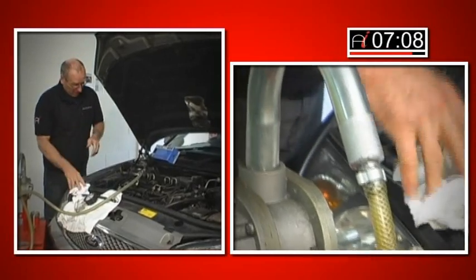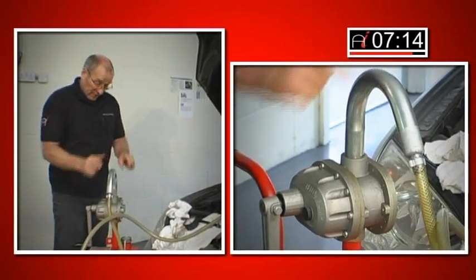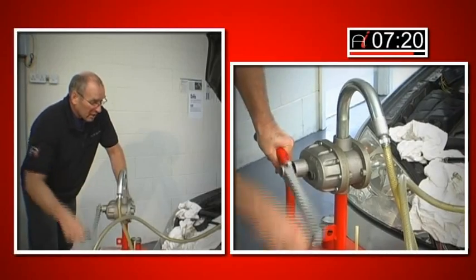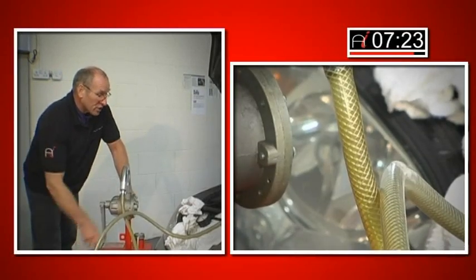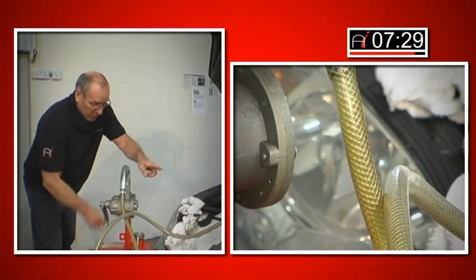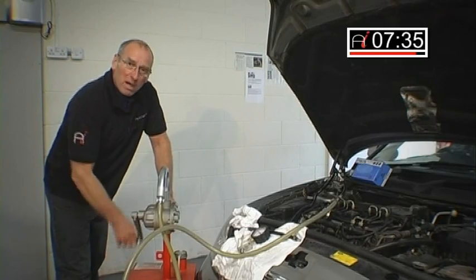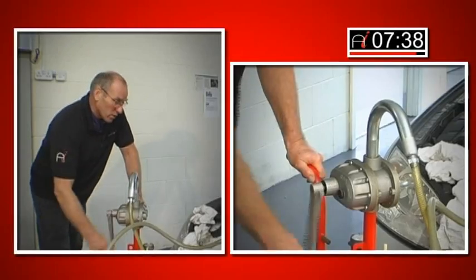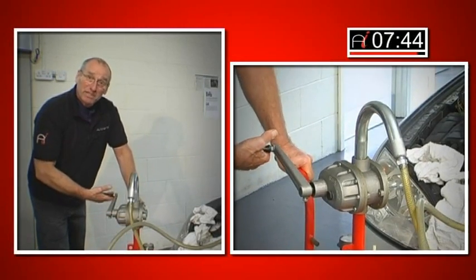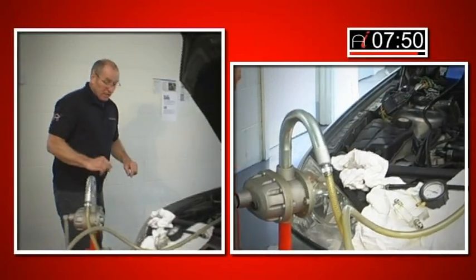Where there's been a problem with a priming pump, if and when it's fitted in the tank, we've actually run vehicles using this pump. So now I'm actually going to technically fill the vehicle — clockwise direction — and we can literally feed fuel into the high-pressure stage, just simply watching the flow through the clear pipe. We could, if we wished, monitor this using the gauge and put, say, one bar of pressure behind this fuel, and literally, as the engine's running, just simply keep up with the supply of fuel. Maintain a small positive pressure into the high-pressure stage, and that vehicle will start and run literally instantly.